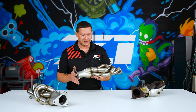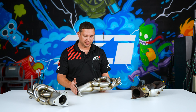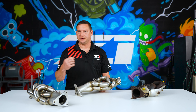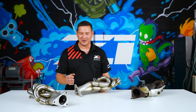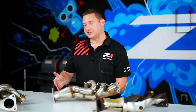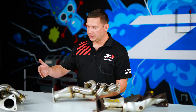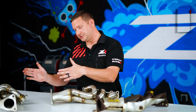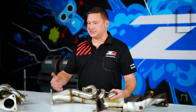The length of the headers is a significantly improved equal length match, better than the outgoing which weren't quite perfect. These are within a fraction of a millimeter by design and we don't see much variance in the construction on that. So the power and performance is better — even the exhaust note is different. If you hear these all the time like we do, you can tell the difference in a side-by-side comparison. The header collector was re-profiled with a larger cross-sectional area to flow more, so we're looking for more power, and it really is complementary in both NA and boosted applications. The transition is a little bit smoother as well — not just the cross-sectional movement, but also the approach is a little shallower — and all of that complements well, so we're seeing better scavenging and better efficiency out of these headers.